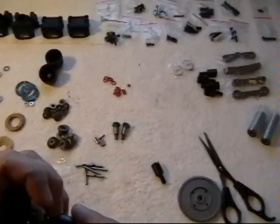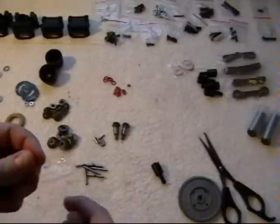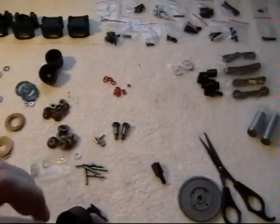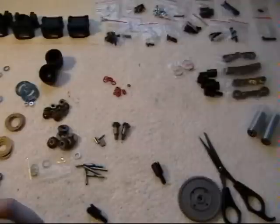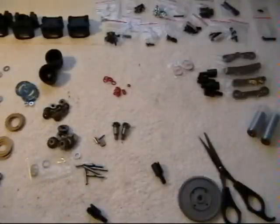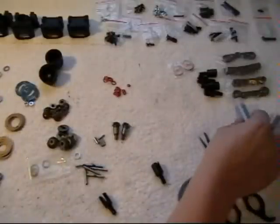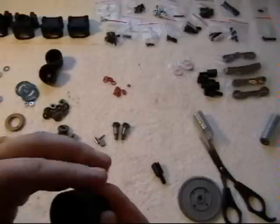We're doing this backwards here. The O-ring is going to go inside the diff case — get her in there. Take the washer and set that down over the O-ring. Take your output with the bearing, snap that in there, and put your output through. I've got her in there — you can see where the hole is. Next item is going to be the lock pin for that.